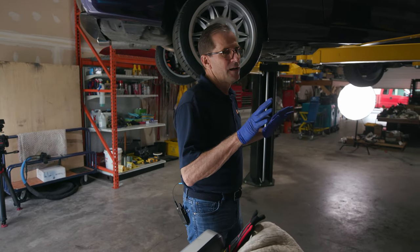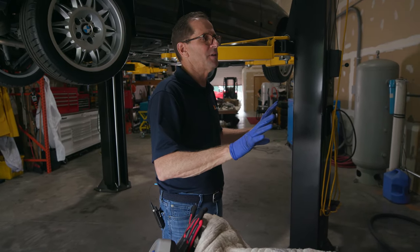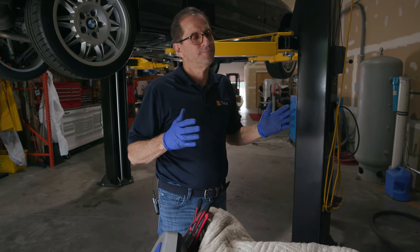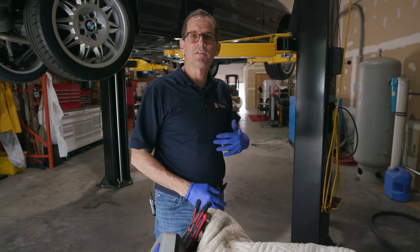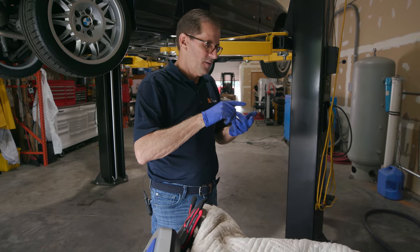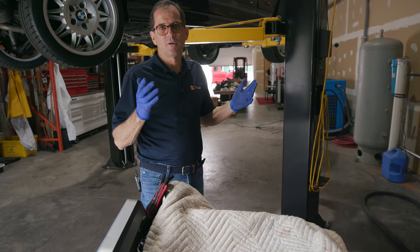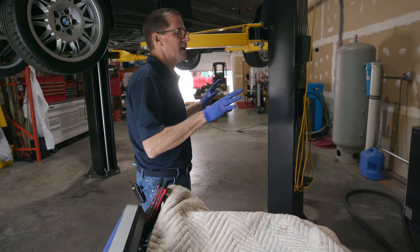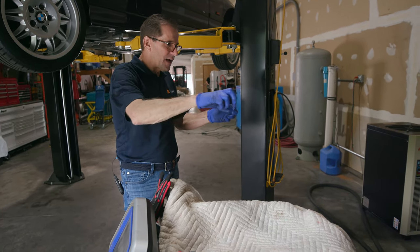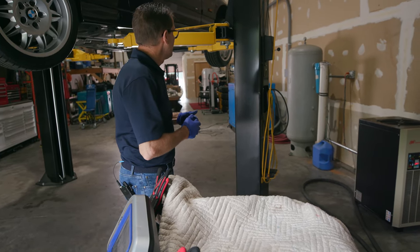because you want to know that too. I overpaid for most of my stuff. But a full compressed air solution, properly sized and installed, is plus or minus, depending on where you are, 30 grand. You can ping me and tell me you got one for 25 or 27 or 22. Whether it's Atlas Copco, Kaeser, Sullair, Quincy, the proper setup, which will look a lot better than this, with all the catchment for the condensation and the oil-water separator so the EPA doesn't yell at you for putting oily water outside, is going to cost you 30 grand.